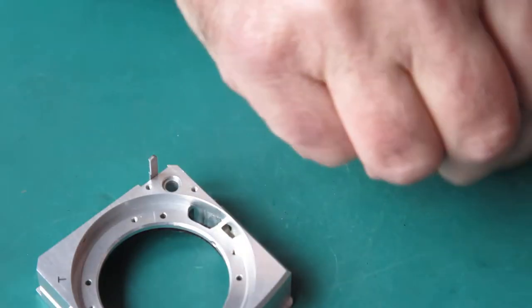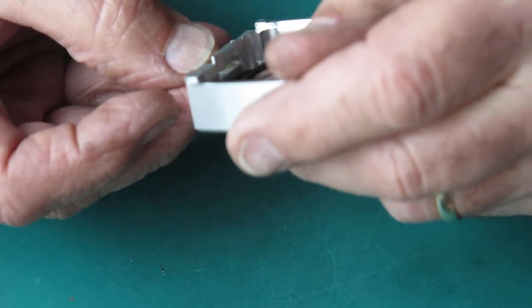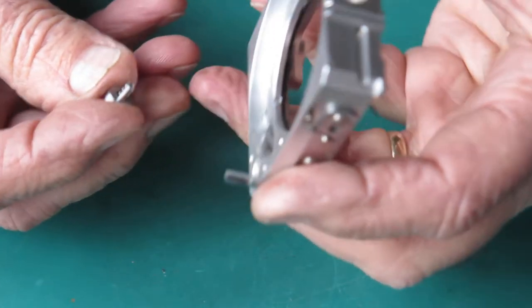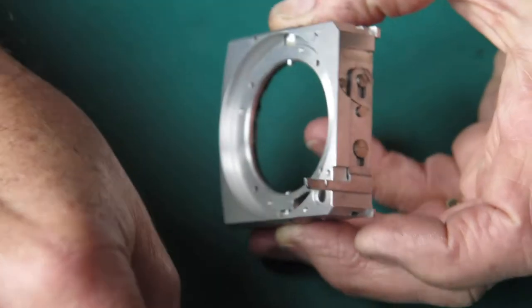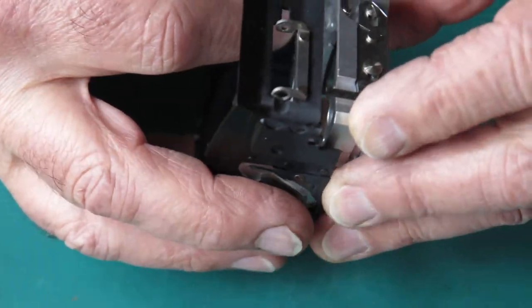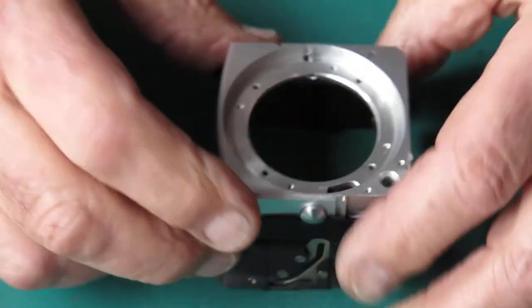Run a little bit of synthetic grease down there and get the springs and the buttons fitted back in place, holding one in place with my finger while I line up the other part. So having those compressed between finger and thumb, I'll slide on the shroud. Now they've popped up quite positively there. That's holding firmly, so straightening up the shroud seems to be the secret there.